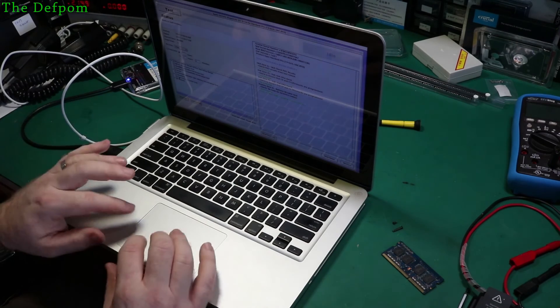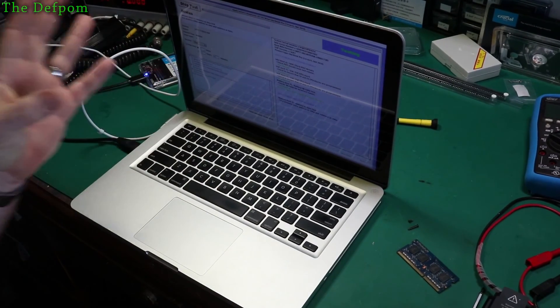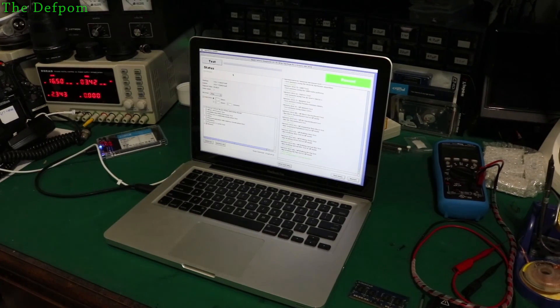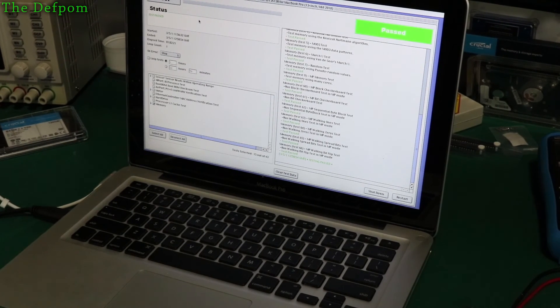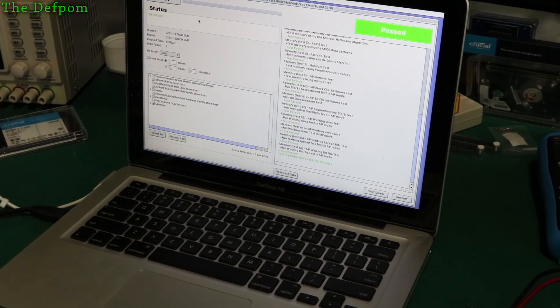Everything else has passed. I've already checked everything — it's only interesting doing memory tests right now to see if it plays up. I think if I can get it to pass on that, then I think the actual unit will be okay. If I can get it to pass memory tests, I'll probably get a new system installed and get it booted up. So as you can see — it has passed. So that's with a 4GB RAM in the bottom slot, close to the keyboard. That's passed, that's fine. If I put it in the other slot it wouldn't even start up. So it's obviously got an issue with RAM slots — hopefully only one of them. I think it's going to be fixed. I'll probably try installing the system and see how reliable it is. It could still be a bad RAM slot, we'll see how we go.